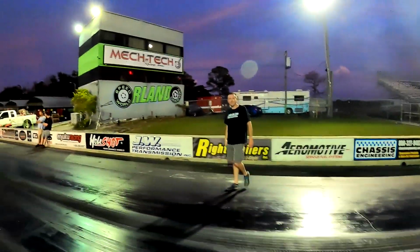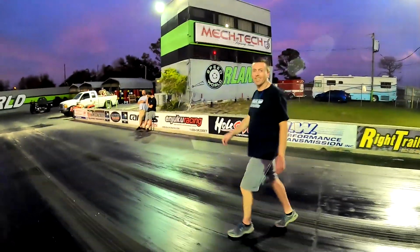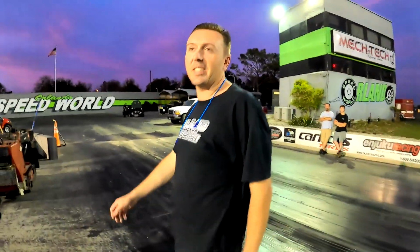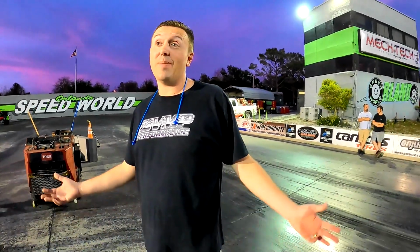That's the fastest time that it has run all day. But how much of that was air temperature, you think? You know, it's 60-footed slower, and from previous experience, that is hot air being sucked out of the engine bay on launch. Yeah. So I'd say that while the airbox lid shows great power gains on the dyno, it's not so great at the track.